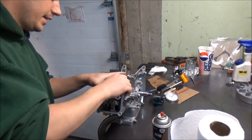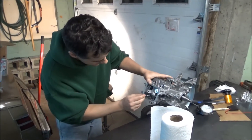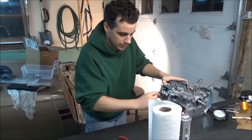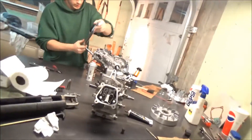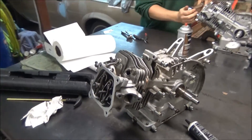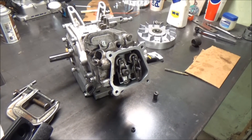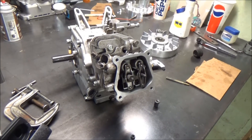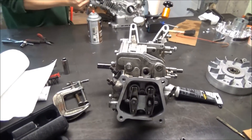The torque spec on this was 17 foot-pounds, but I have a feeling that was with a stock head gasket, so I'm not afraid to go a little bit over — I definitely don't want to strip anything out but I'll go a little stronger than 17. We've been covering Mike's Predator motor quite a bit this episode. On the GX200 clone — voila, it's almost all done. I have everything bolted in, head bolted on. I believe the torque specs for the GX200 was 18 foot-pounds. I'm just getting my rockers and the rest of my valve train put together while Mike's finishing up the Predator.